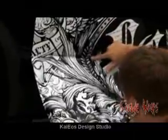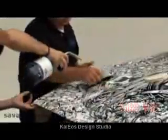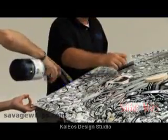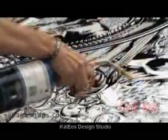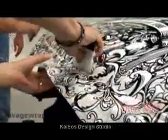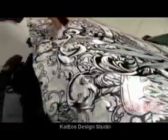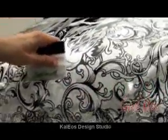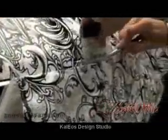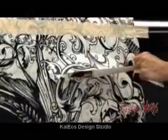Wrap vinyl is not the same as sticker material. Wrap vinyls are more durable and more conformable to the contours of a vehicle. It's often necessary to use heat torches to help conform the vinyl wrap to the vehicle's curves and indentions. Trimming off the unneeded vinyl may be the single most important detail for a quality wrap. Fellers certified wrap providers don't take this detail lightly.